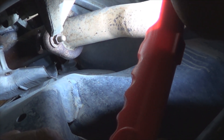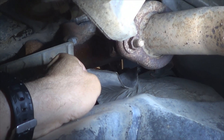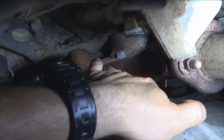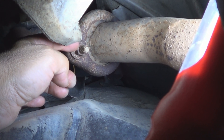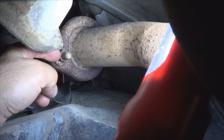For the next step, working from underneath the car, remove the nuts — there are two on each exhaust flange — that fasten the exhaust pipe to the exhaust manifolds. It's not necessary to remove the manifolds from the cylinder head to get the heads out of the vehicle, because it would be too hard to get to the lower manifold bolts anyway. You may have to spray these studs with liquid penetrant to make sure they come off easily, otherwise you may break them off and create more work. Do this on both cylinder heads.